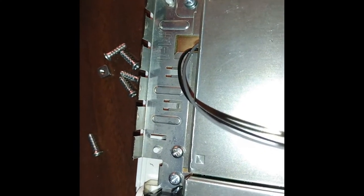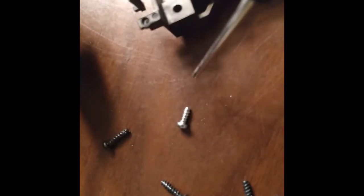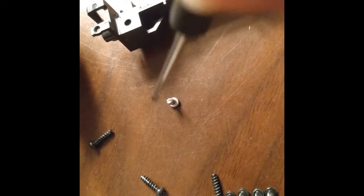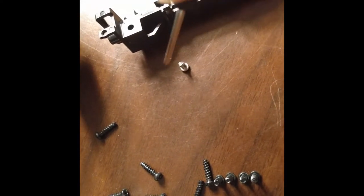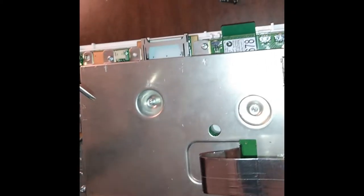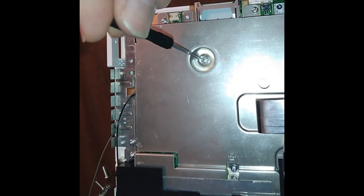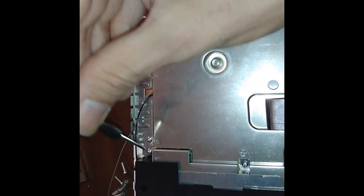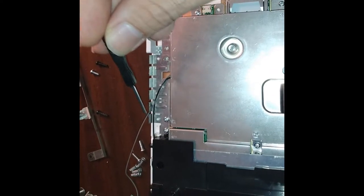The only marking that's a little confusing, here you have an arrow pointing to this screw. It's basically asking for this screw here. It wants a little silver Phillips head screw like that one. This marking in every other place on this board implies short screw straight through the motherboard to the case, except for here, where it goes through this plate too.